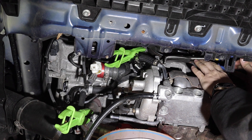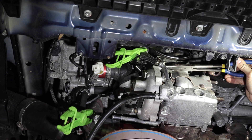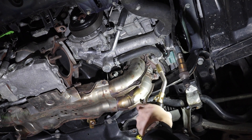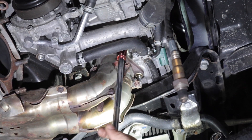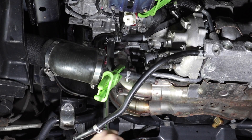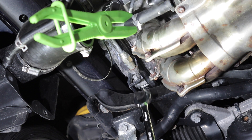I'm trying to get the coolant hose on the top - it's difficult to get to. As soon as I crack it, it's draining. We got everything disconnected from the turbo. Now we're going to move on to the three nuts that secure the header and turbo assembly to the head. Also remembered the oil feed line - using 17s to get that off.